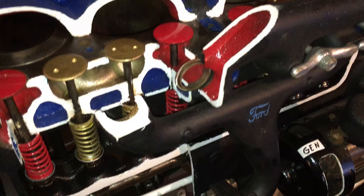On the lower right of the screen, you can see the generator, which is used to keep the 6-volt battery charged. The battery serves two purposes: one is to provide power to the coils for spark while starting the vehicle, whether by the hand crank or by the electric starter, which was available starting in 1919.